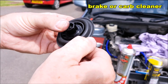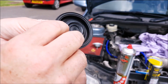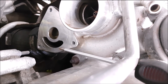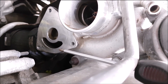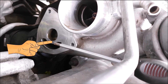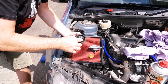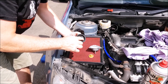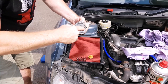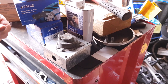The diaphragm has a lip on this side on the edge which locates in the cover, and in the middle on the other side it has a ridge. The outside lip of the diaphragm locates around the periphery, and that inner ridge locates here. Being spring-loaded from behind, this inner ridge is pressed against the turbocharger casing.